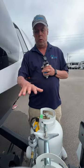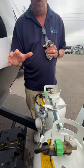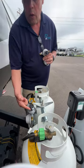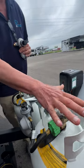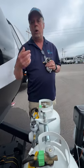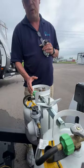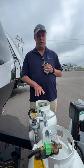So what we're going to do is talk about this and then I'm going to show you on this regulator. When you go camping, you're going to turn on both tanks. The regulator is going to be pointing at one of the tanks, meaning it is using that tank. When that tank runs out, it's automatically going to switch over — a pressure differential occurs and it switches to the other tank.